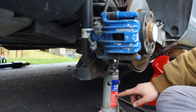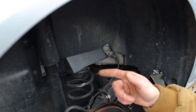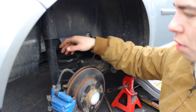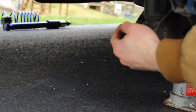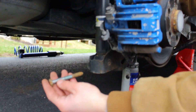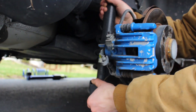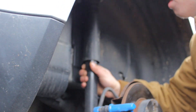One thing I've done earlier was put this jack underneath the axle beam just to kind of jack it up, because when you drop this, the whole thing could potentially drop. As you can see, it slides in and out like this to the other side. So if we pop that out, that's what it looks like. Then your strut — if you maneuver it, you can pull it out.